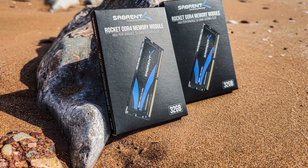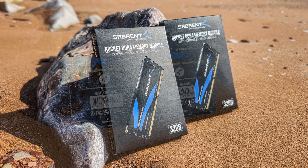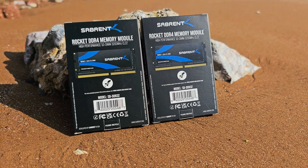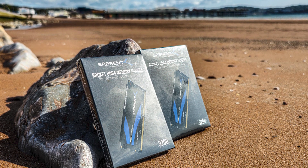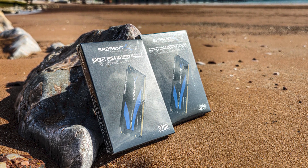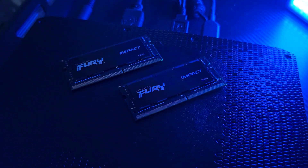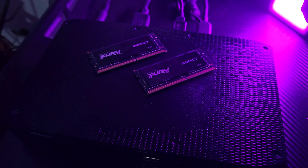Let's have a look at a 64GB DDR4 SODIMM kit from Sabrent's Rocket series that runs natively at 3200MHz CL22 and more importantly at 1.2V. It retails for around $150, which is not bad considering you are maxing out most dual channel DDR4 SODIMM machines. Its main competition, at least from what I can see at current prices, is Kingston with their Fury Impact models which offer better timings out of the box but understandably cost more.